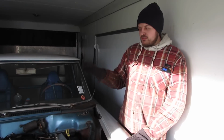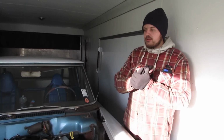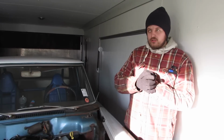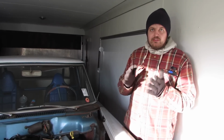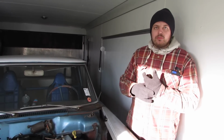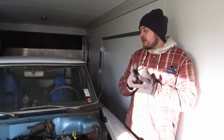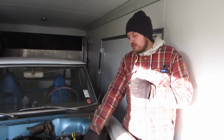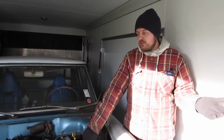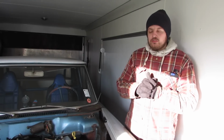If I had to make a conjecture, my guess would be that the cylinder head could produce more horsepower. Say we went to an 06 and later head, I think it could produce maybe 20-30 horsepower more, but I think the turbo is also out. They rate these turbos at around 600 horsepower, that is crankshaft horsepower. At 460 wheel horsepower, we are at around 540 crankshaft horsepower. So I think we're pretty close to the limits of the turbo as well.